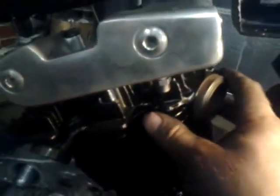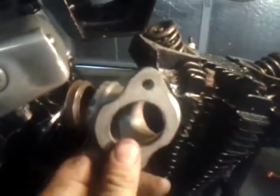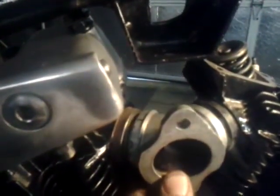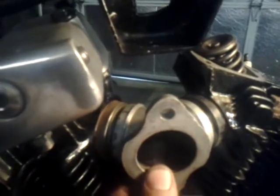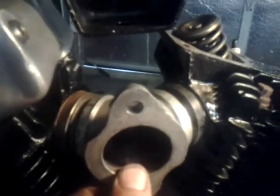Then you can put your head on. It also helps with this back bolt — put this back bolt in, the head bolt — and over here you can just run these in. I have 12-point head bolts. I'll turn these down, check it again, and I turned the head bolts in a little bit — they're not torqued yet, just light. Hold it in there, and the more time you take straightening this up, the less chance you'll have intake leaks. You want that looking nice and even.